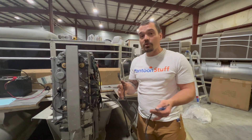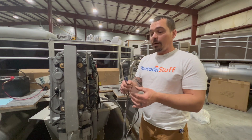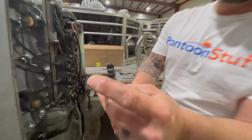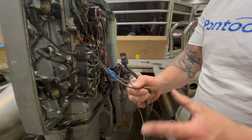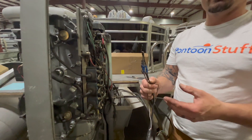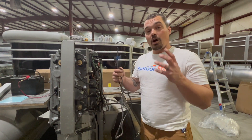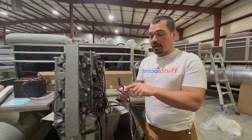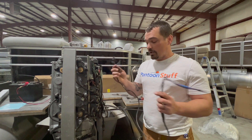There may also be a blue wire in there, which powers your backlighting for your gauges. When you get to your gauges, if you're going to replace them, just cut as close to your gauges as possible. You're going to leave purple, gray, black, and maybe a blue wire. This was cut from the old gauges — I taped this together to keep it, and what we'll do is when we redo our gauges, they typically come with a harness. You just splice these back in and your gauges will power from the original harness.